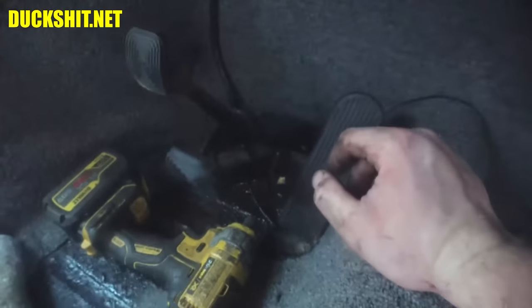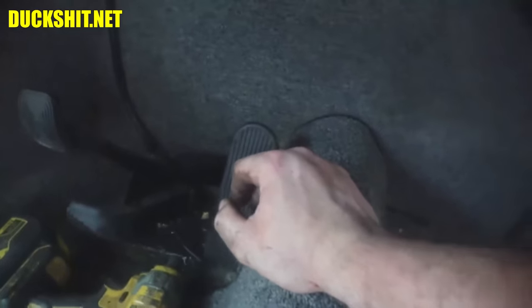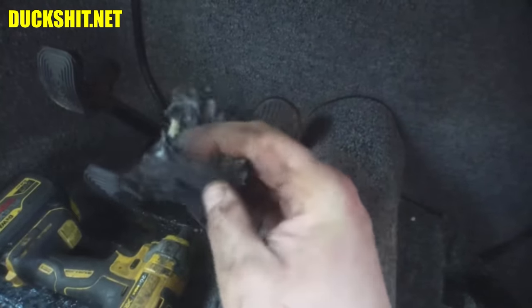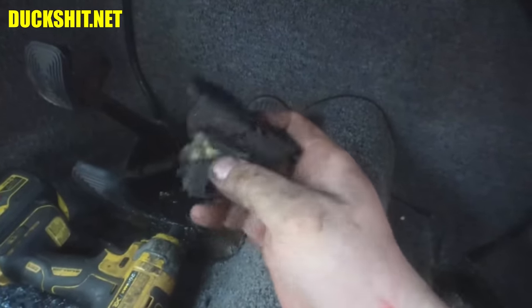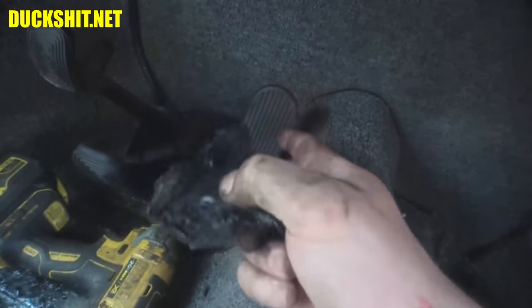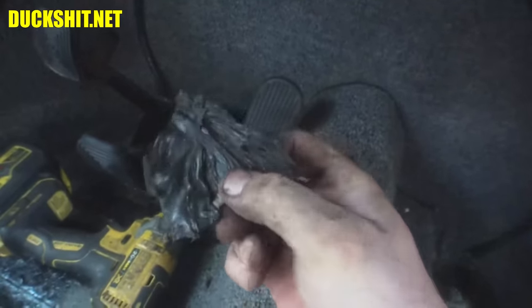Well, again, that's outside of what I'm doing today because this wasn't what I expected at all. Whoever had this service last did a pretty good job of covering stuff up with this rubber paste so you couldn't see all the rust damage that was up front here. Now, what I understand is the floor pans in this have been replaced at some point in the past, so I think instead of repairing this portion of it correctly, somebody shortcutted it.